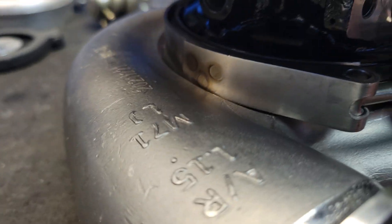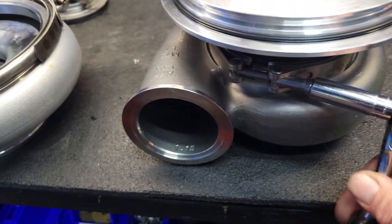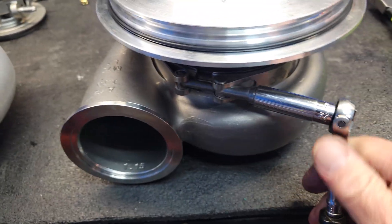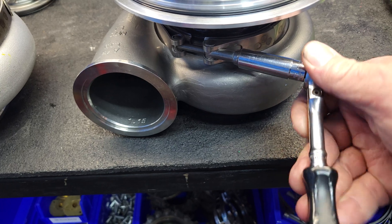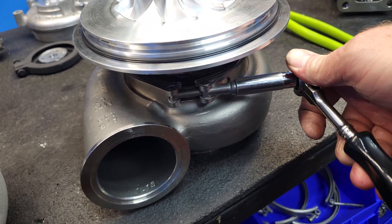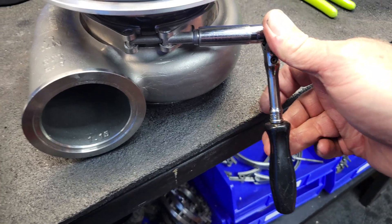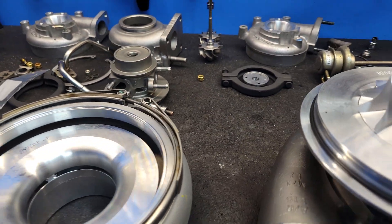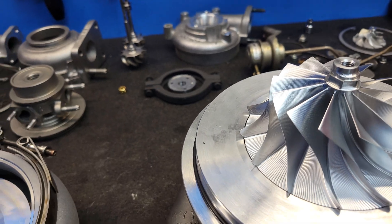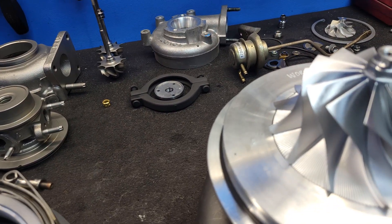V-band clamps. I'm checking to make sure this guy will still float — we have no contact between anything. Everybody will tell you these things have a torque spec. If you're working on an airplane, they do. I'm going to give you the quick, easy way: quarter-inch drive ratchet. At that point I've got resistance — I'm pulling up with thumb and pinky finger, and I've got some pretty good resistance. This thing will continue to tighten and will eventually just break itself, so — thumb, forefinger, until it snugs. Once it snugs, plastic hammer. You want to tap around the clamp and make sure that it is seated. At that point you can go back and give it one more little pull. It's very important to seat a V-band clamp.